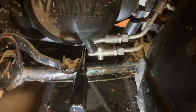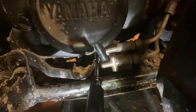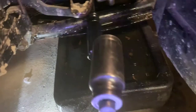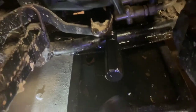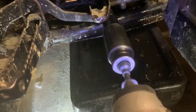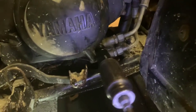I finally got that little cover on. There was a little o-ring that fell out — I'm pretty sure it just kind of goes in the middle of the cooler lines because that's the only spot where there's a little hole for an o-ring that size. Next I'm going to take this electric impact — I have a 22 on it, this is why I like the Craftsman — I'm just going to pop it on there and cinch it down. I'm not going to over-tighten this just because I don't want it to strip out in the future.